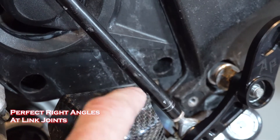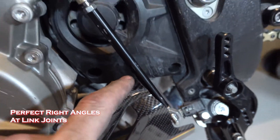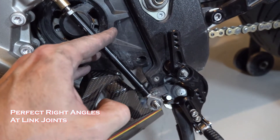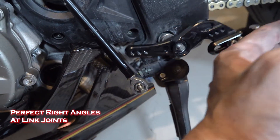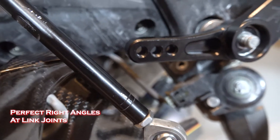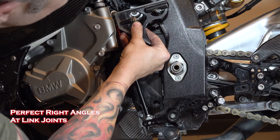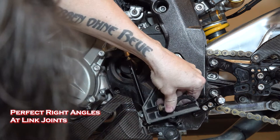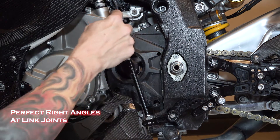I just need to get the die grinder out and chop a little bit more off right there for clearance. I've got the links in that shift link all set to where it looks right, with a little bit of blue Loctite on there. I'm going to bolt that back in — putting it in that middle hole to give a little bit more leverage over the furthest inward hole where it was before. Now I'll check our angles again. Both points look straight across and straight with the shaft. We're trying to make 90-degree angles everywhere we intersect.